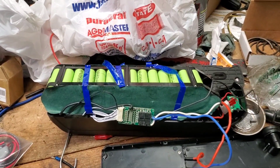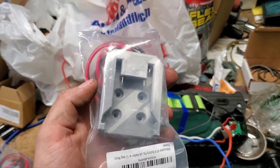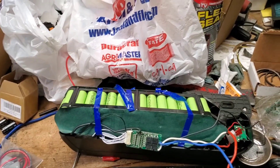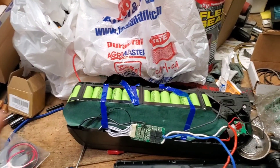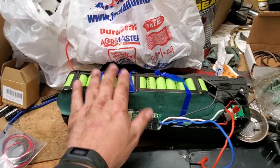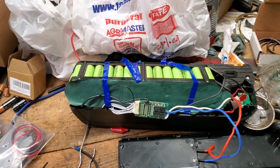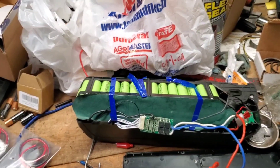I have a plethora of nine amp hour Milwaukee batteries at 18 volts. I got some adapters here — there's a guy online that 3D prints these. Basically it just taps into the plus and minus of your Milwaukee battery and has some wires. I'm going to wire two of those together in series to get my 36 volts. I did bench test this — I set up two Milwaukees on my bike and ran some jumpers and wires down to the control unit. It did power up and run. I took it for a spin in the backyard and it seemed to have just as much power. This old battery had around 10 to 12 amp hours; my Milwaukees have nine, so that should work out fine. I'm going to show you how I'm going to set this up and then we'll do a test run.